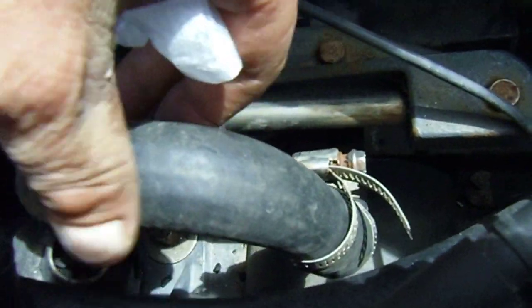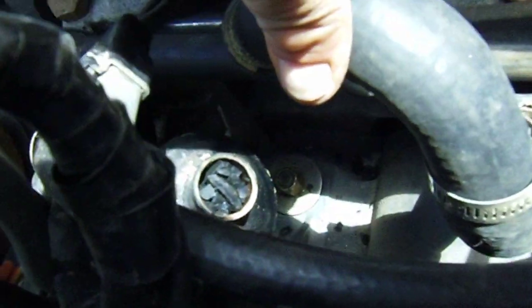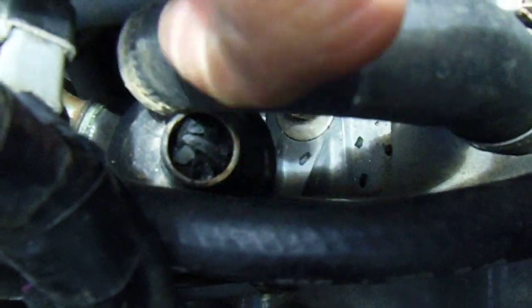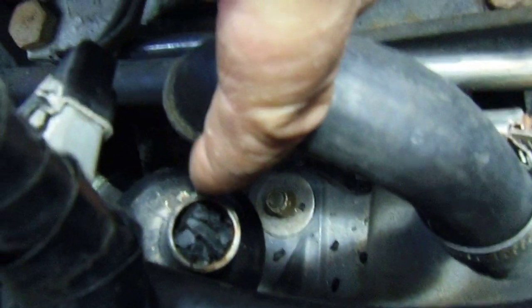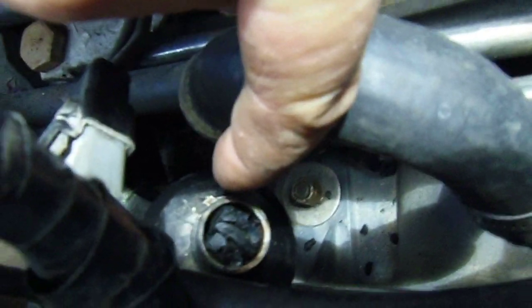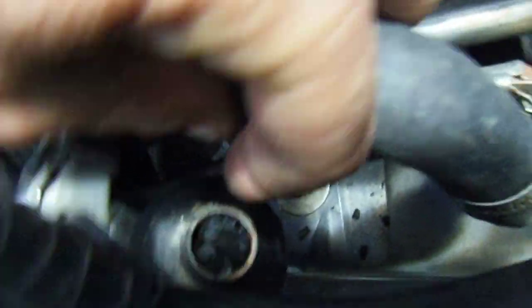This brings the water into the engine, but it runs through a cooler. Okay, if you look there, you can see it's full of crap right here. It's full of old impellers. It's totally stiff, so the water wouldn't be running through, and he'd be burning impellers after impellers. I got about 10 kits with pump kits. It takes about 5 minutes to change the pump on these OMCs 86 and 93.